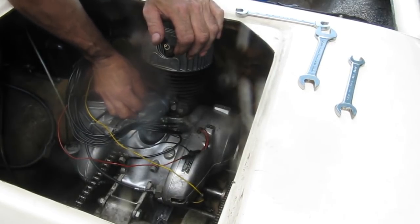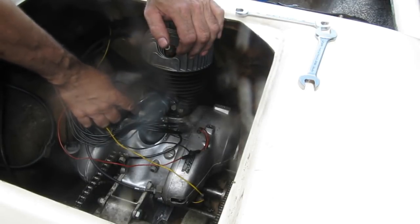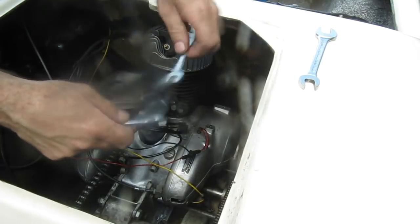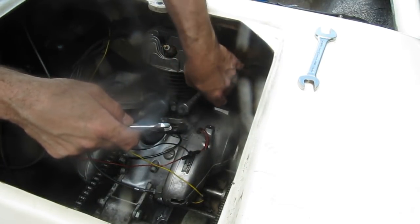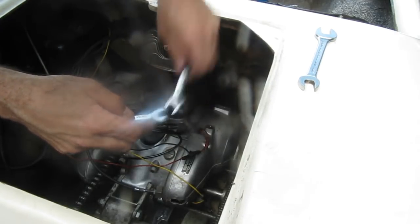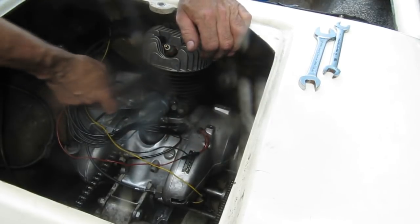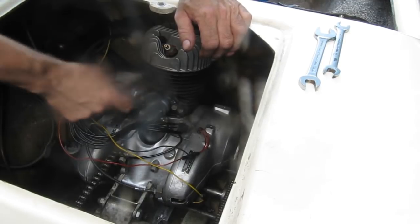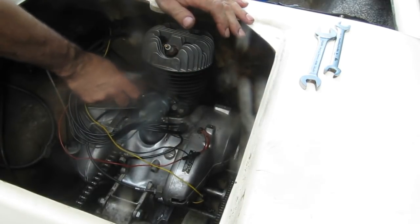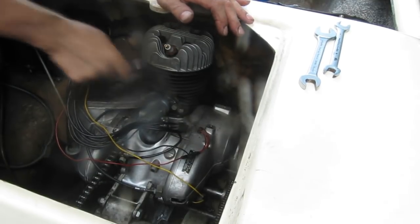Screw this in by hand. This is faster than working on it with the wrench at that spot. And the British standard wrench I'm using says 3/16 on it. And if I take a 1/2-inch wrench, the 1/2-inch wrench is a little big. The 7/16, oh, just barely fits. So, not sure how the British standard wrenches are measured. And then snug those up, tightened evenly. Again, not overly tight. There are lock washers under these screws. This is the tough one to get onto without rounding it off. Get that one snug.